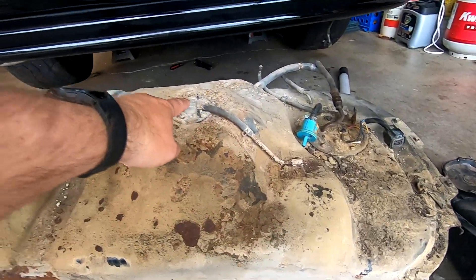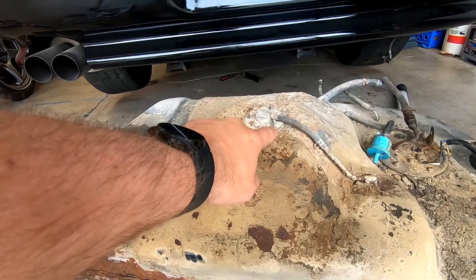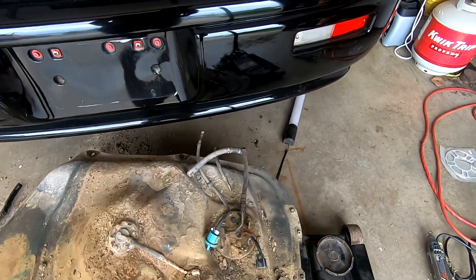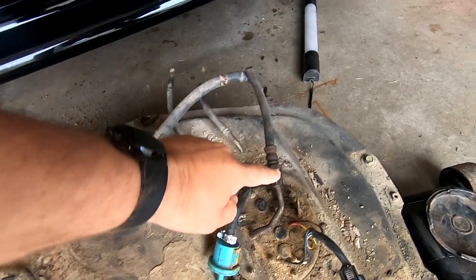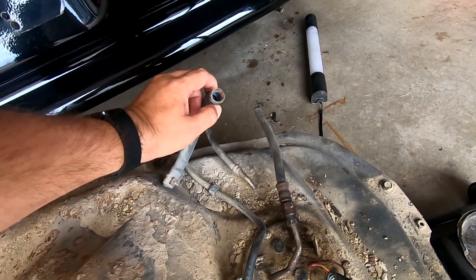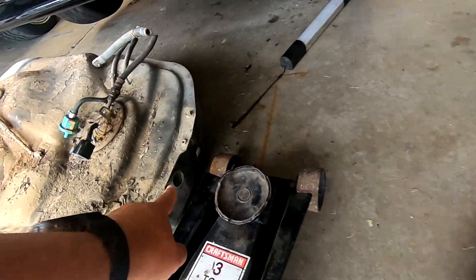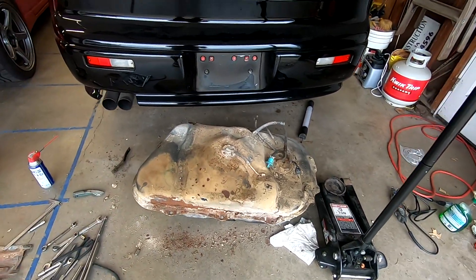You have this vent and spill-prevention setup — so if the car rolls over, gases don't dump out; it's a check valve situation. I believe this is your vent line, that's the feed line, and I think this is the return line. This one I think is for venting when you're putting gas in, since the fill port is down there. I'll put you guys in speed warp while I'm in the yard cleaning it up and we'll see if we can get this thing apart.